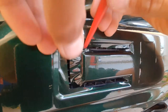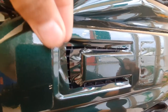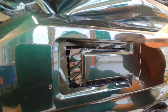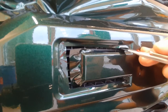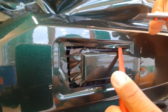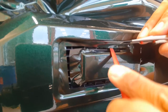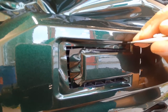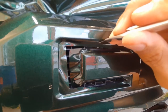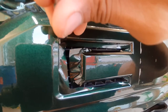I want it lined up against that ledge so when I cut it'll be a nice clean straight cut using the side of that emblem itself as a guide. Make sure when you're about to cut, snap off a new blade so it's as sharp as can be. I'm using a carbon black blade which is sharper than the regular stainless steel type. You can see I have the side of my blade up against the inner flat of the emblem lettering, and I'm taking my time because I don't want to cut or scratch the emblem, plastic, and paint.